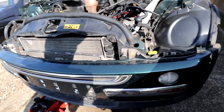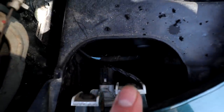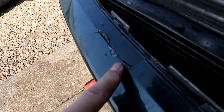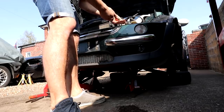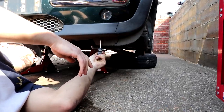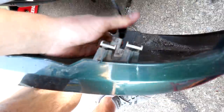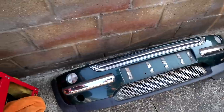I don't think there's an awful lot holding this bumper on - literally a screw here, some torx screws, a couple of bolts, and a couple underneath as well, then the same on the other side. This is the reason I'm changing it - you can see it's all cracked. And there she is - that's the old one off.